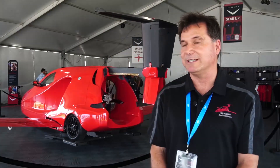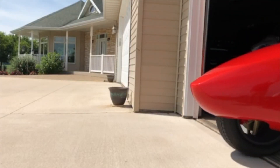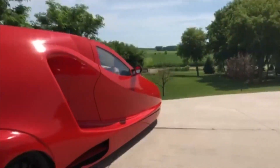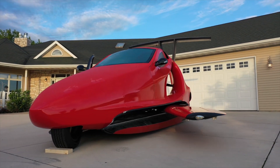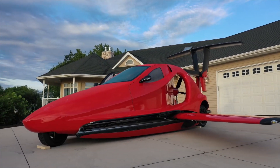The Switchblade is majorly completed at this point. We're getting it ready for flight testing. We finished the engine installation, radiators, designed and built the flying car transmission — no small feat. We put in the propeller disconnect mechanism so we can disconnect the propeller on the ground. All the drivetrain and running gear is pretty much intact and ready to go. All we have left is to replace the starter in the engine that's a little bit weak, and then we'll go forward and do engine start, tuning, taxi testing, and flight testing.